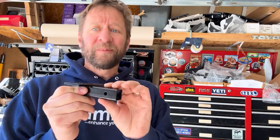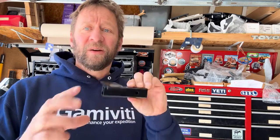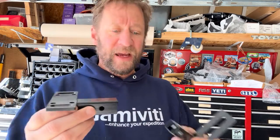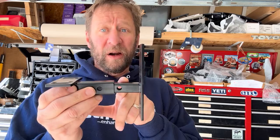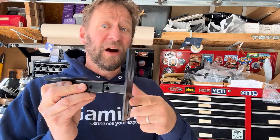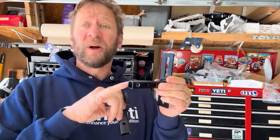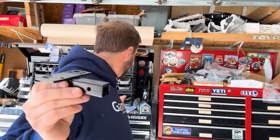As you probably know from the product or other product videos, the original was and is a 1-inch square tubing welded to a plate bolted to your roof rack. And then inside goes a 3/4 inch square welded to a plate that's gonna mount to your awning. So this piece doesn't really change much. We added one hole, no big deal, but this piece is now a single formed sheet metal part, which looks like this. So how is it different?